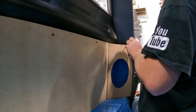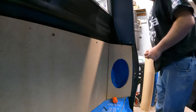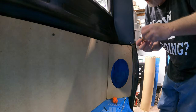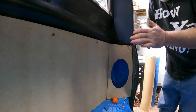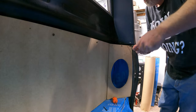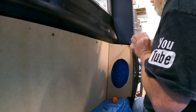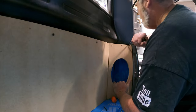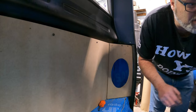This one's got to go in too but we're going to need a bigger screw for that one. I've already drilled a hole to line up so I should be able to hammer this right in. Is my six-point iron going to fit in there? Probably not. As you can see, I put blue skin in there too — she's going to be acoustically designed to sound decent. Come on, hit some metal. I think I got her first shot! Did I ever tell you how much I hate hand-bombing? There it is — nice and tight. Now let's grab the speaker, throw it in the hole, and see if it fits. We are going to use a power tool for this.